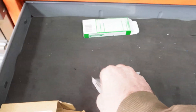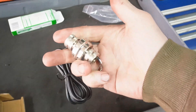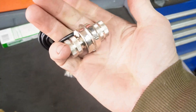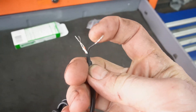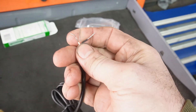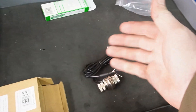The way it works is it intercepts the actual cable. You have to modify your cable slightly and then insert this device in the cable. So what we're going to do today is modify a cable and set this up so that we have a digital output, then I'll run the wires up to my plug. What we've got here is ground, and then a power and a signal wire. This should output a 12-volt signal, and because I'm running a Haltech I can calibrate that input to do what I want.